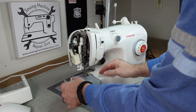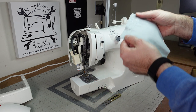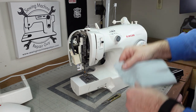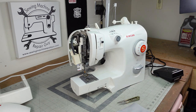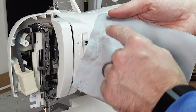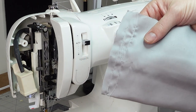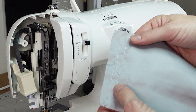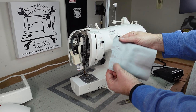That is much better. We didn't get any picking that time — the fabric fed straight. If you didn't notice, when it was picking it was pulling the fabric off to the side. That can happen just with a needle, and as you saw before the needle was dragging across the metal part of the hook, and that was enough — even when I was testing it by hand — to ruin that needle.